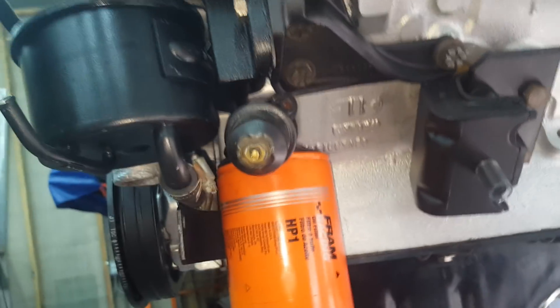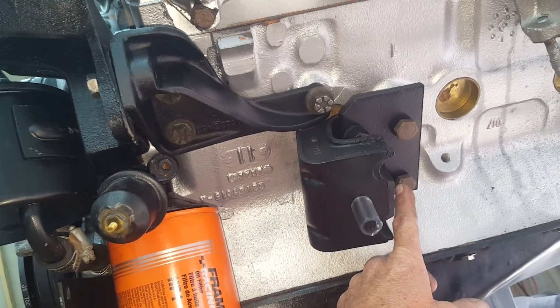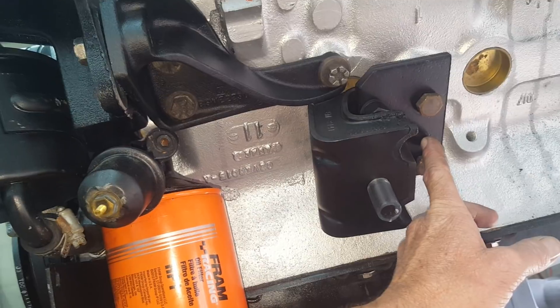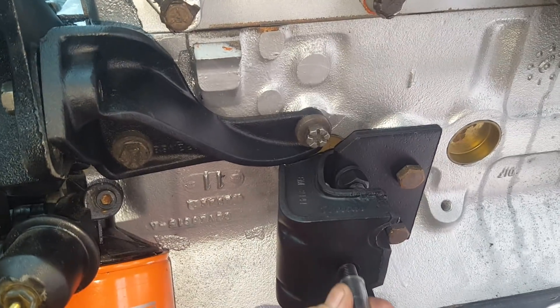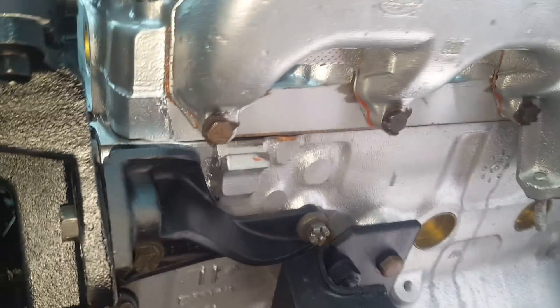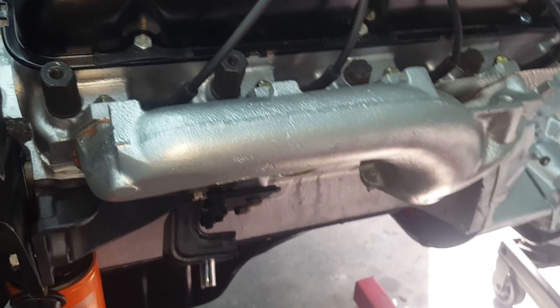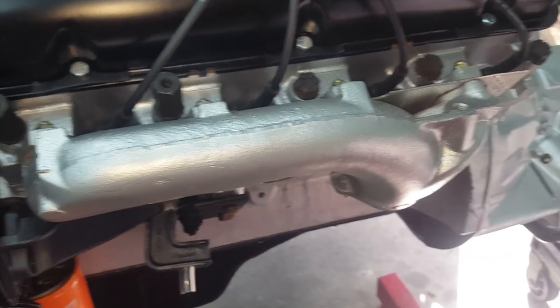You can see the stainless steel bolts on the oil pan — I used grade 8 wherever necessary and stainless steel in other places just for looks. The motor mounts can be tricky on a convertible; they have an extra plate to move them forward a little bit and can be difficult to find and expensive. For the exhaust manifolds, I applied a heat coating underneath and high-heat paint to try to combat the notorious vapor lock these engines and motor compartments have.